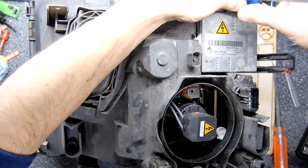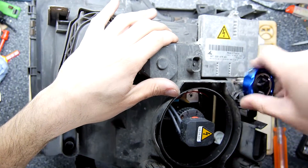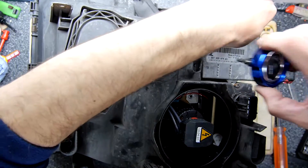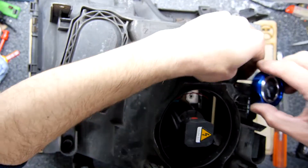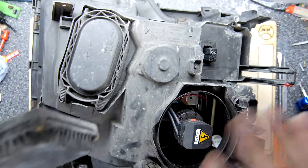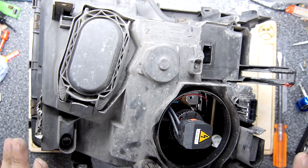I'm going to make the effort of undoing this again because I know we're going to need to. What I'd like to do is get the actual xenon bulb out because I want to check the bulbs, check the connectors, check the PCB — clearly this one's been running without a cover for a while, you can see the cover's missing. It was doing a bit of flickery action and we thought it could be this.